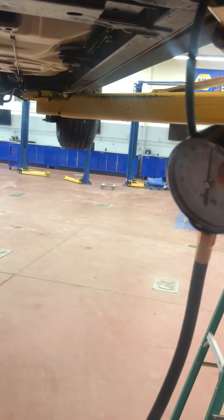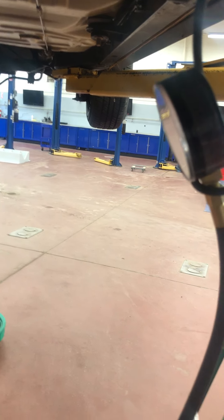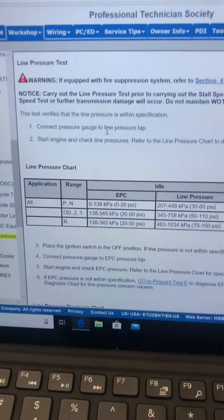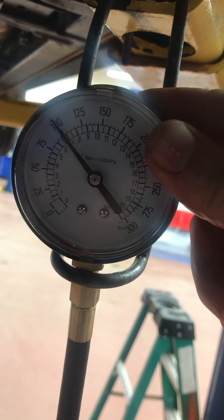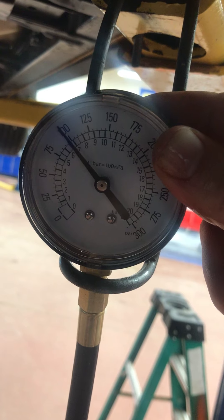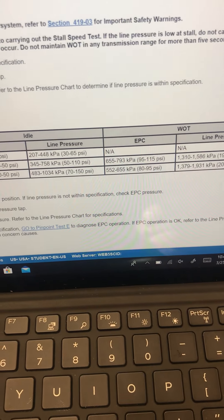The next test that we can perform is going to be for our drive gears — 50 to 110. Gotta give that a couple more tugs. There's neutral, which is basically the same as park. Match drive right there. What have we got? Pressure is right under 100 — 90 to 100, somewhere in that range. Take it to the chart, or inspect there as well. Now if you scroll down on this, it will actually start to help you troubleshoot what could cause some of these different issues.